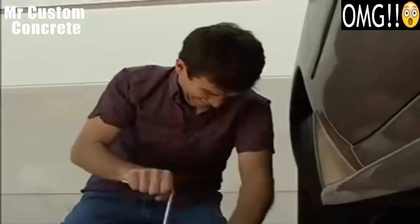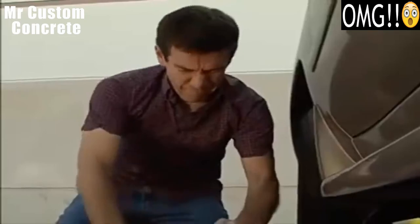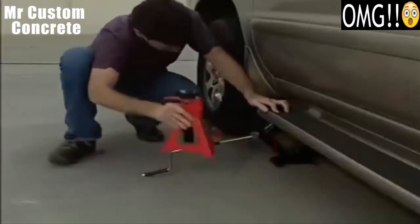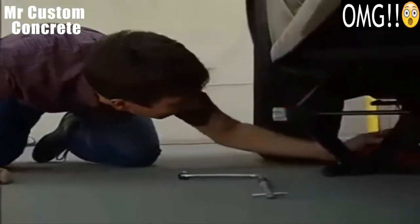Every shade tree mechanic and do-it-yourselfer knows the drill for safely raising a vehicle for servicing. First, you jack your car or truck up using a bottle or scissor jack. Then you place jack stands underneath the car. Then you lower the vehicle onto the jack stands. Then you remove the jack and finally get to work.